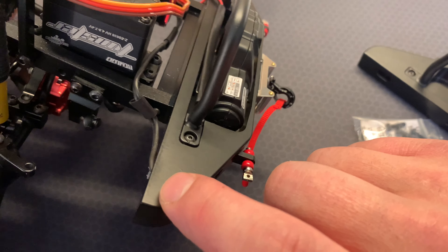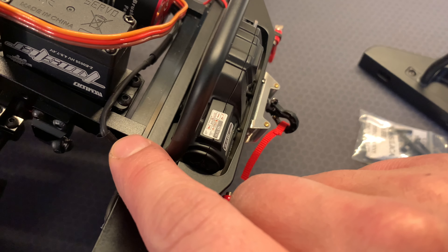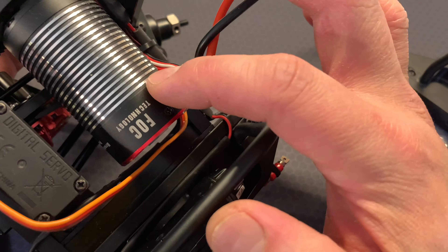I just want to show you how I wired these and where I routed the wires. These heat shrink wraps have been placed here, and once heated up they harden to create and retain a shape. Do remember that you do not want to run your wires across the top, because when the hard body goes on that's exactly where it's going to rest — eventually wearing, flattening, and probably damaging them. So route them to the back, being careful not to touch the motor. On each side the wires are routed along the sides, coming across neatly into the chassis.